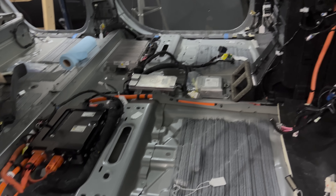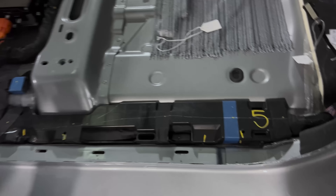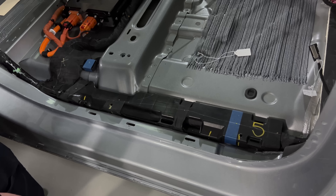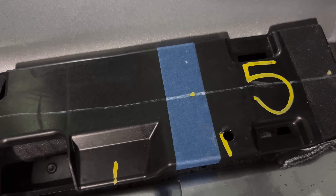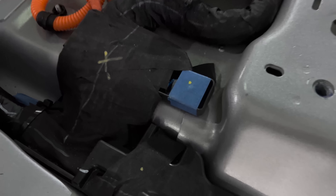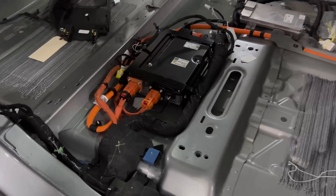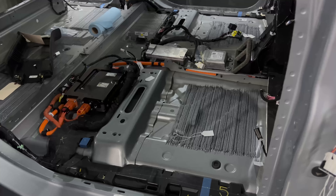Point of concern on the troughs: we have blue painter's tape in a few spots and those are paint marked, meaning they were quality inspected. Normally we would see a vinyl electrical tape wrap or something like that, but painter's tape is definitely out of the norm and I question the need for it. The only quasi-application I've seen close to this is on Hyundai vehicles — they tape mark the left side of the body harness versus the right side, but that's done with vinyl tape, something more durable than masking tape. In Rivian's case, they're both blue, so we can rule that out as a possibility.